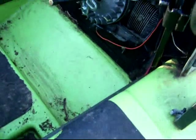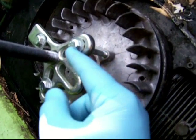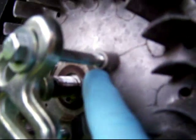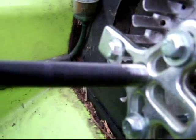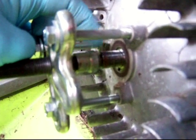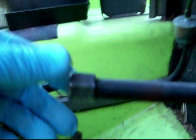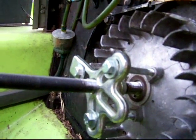And now to put on the puller. Okay, this is the puller that I use. I don't think these are the same 5/16 bolts that came with this. These are longer, I think, than what was available in this kit. But notice I thread them to all about the same amount of thread sticking out, and that's to make sure that the center pin pushes straight on the shaft. So what you'll see here is the point of the wheel puller up against the main shaft of the crankshaft of the flywheel, and these guys are snug but not too tight. And then next thing is to tighten this up, and I'll use a crescent wrench, and then we hit this with a hammer, and it should just pop the flywheel right off.